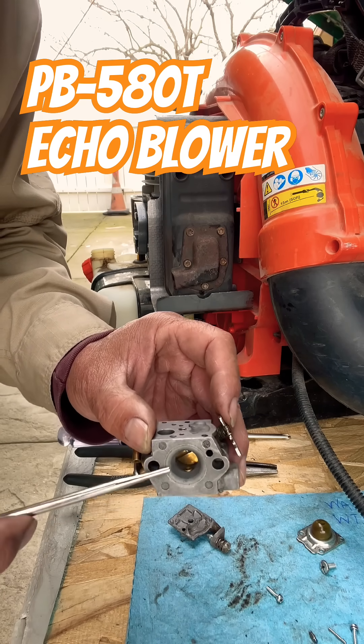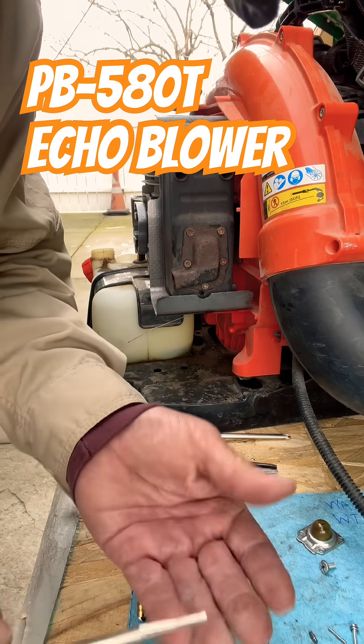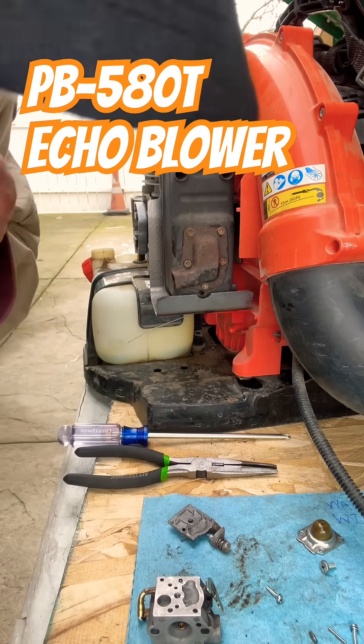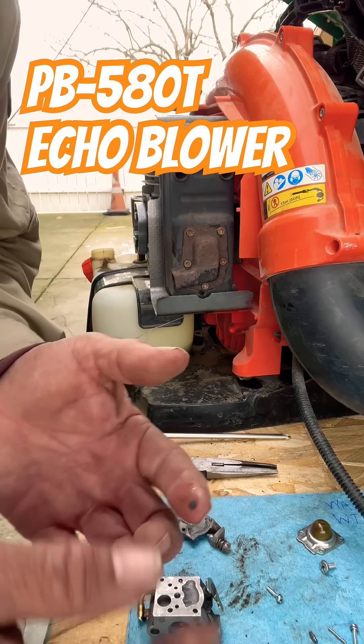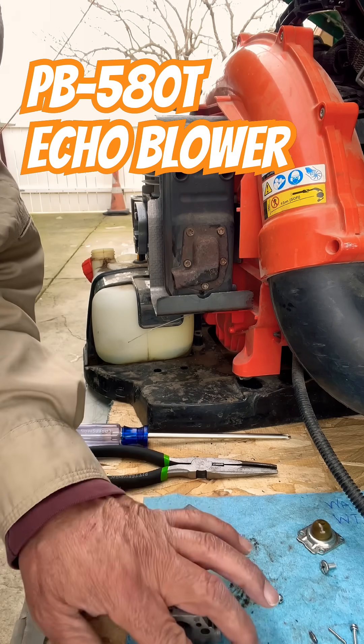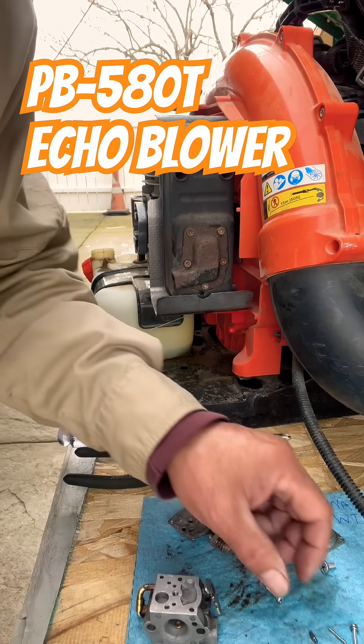It's time to replace this carburetor. Unfortunately, that little tiny guy just made all the difference in the world — and you can see it, it's tiny. It's a Teflon disc that came out of its position and made this carburetor inoperable.